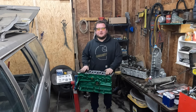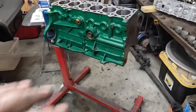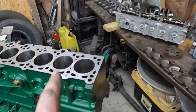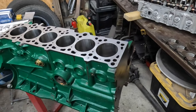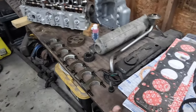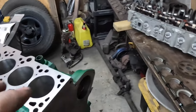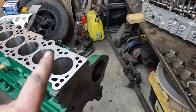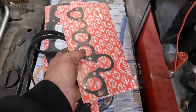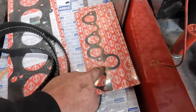I have finally collected all the parts to put together the long block, so let's put some bolts in. Before I start assembling, I want to talk about some parts, because especially if you're in North America, this is quite the obscure engine and you may not be able to find them so easily. Both a blessing and a curse, this shares a lot of parts with the Volkswagen 1.6 IDI engines. The intake and exhaust manifold gaskets I have bought for a 1.6 — we'll be able to use these.